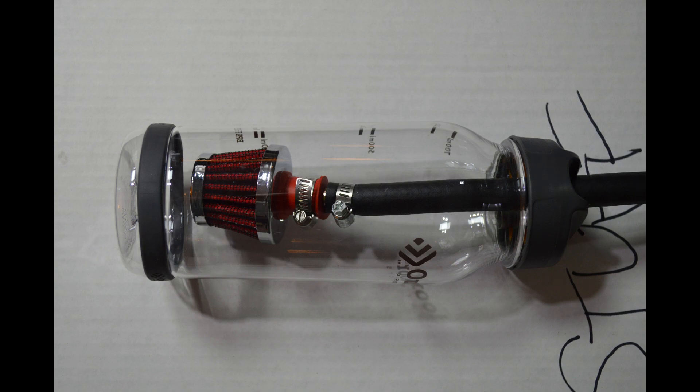Sooner or later, that pressure or vacuum is going to build up enough. Nothing's going to happen to the metal itself, but the axle seals are not metal — they're rubber. So sooner or later, they're going to give. When that vacuum pops, it's probably going to draw contaminants and possibly water into your rear axle, contaminating your lube and eventually contributing to bearing failures and also possibly failure of the ring and pinion because of foreign material ground up in between there.